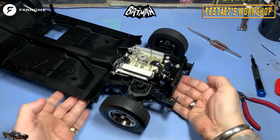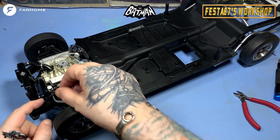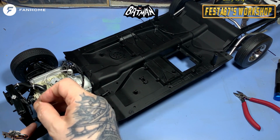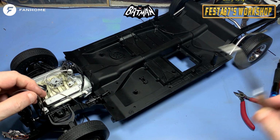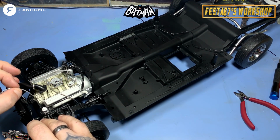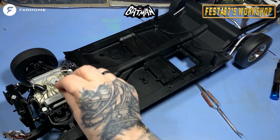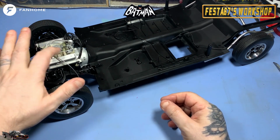So that's that done. And it's now telling me to bring that all the way up behind the alternator and feed it up round here. So let's get that all fed through and try and sort that all out. So we're going round the back of that and through there. So let's try and just have a bit of a surgical move round to some of these pipes. But send that all the way behind there. Like so. Let's move them. And then that is coming up and going round into the side of this carb. Right, so that's all the pipes done.